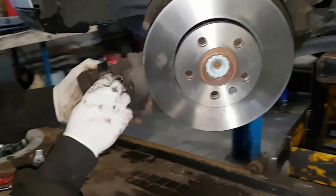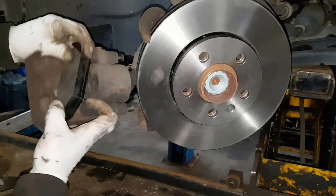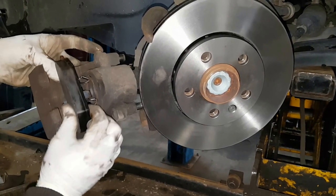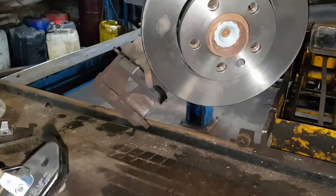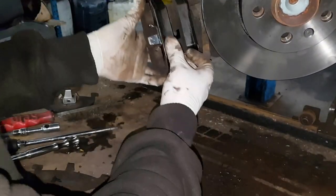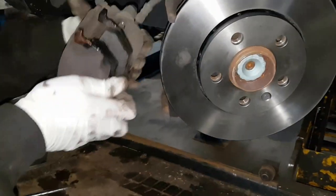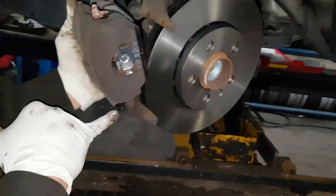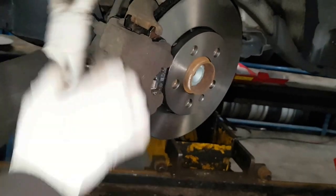Once you've done that, got to push them in. That's on. Then you do the same thing with the other pads as well. So put them on like that. There we go. When you do put the calipers on, if you see this gap here, push it in. Push the calipers down. And that's shot